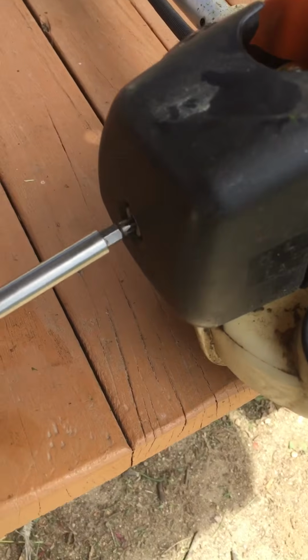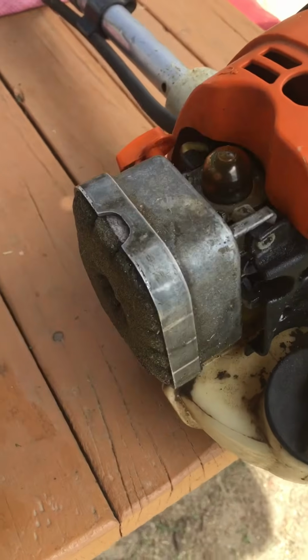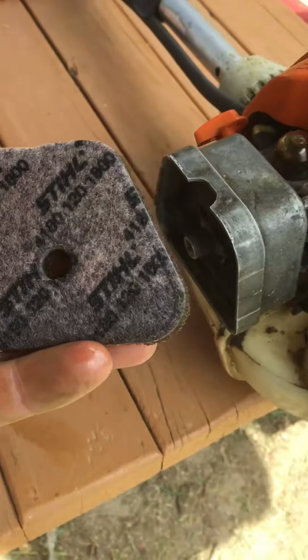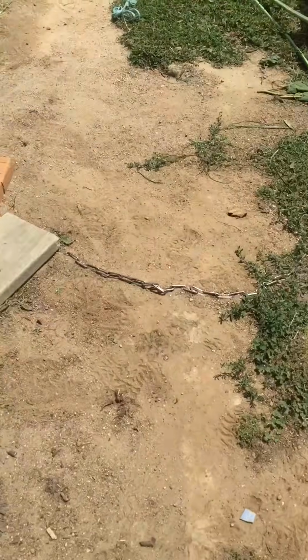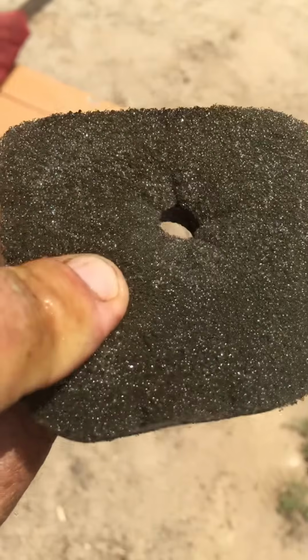and checking the tappets and changing plugs, spark plugs. This air filter in here, because this thing splatters petrol while it's running, this thing clogs up, and so I sprayed it out with degreaser. It's still pretty wet. Both sides sprayed it with degreaser,